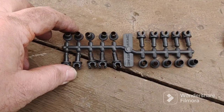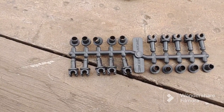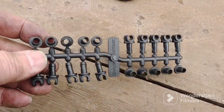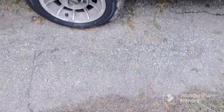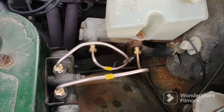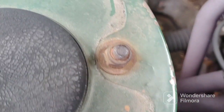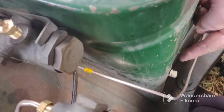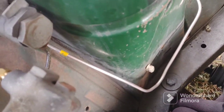Moving along — I did the left front, and I did the two brake lines coming off the master cylinder going to the proportioning valve, which I'm going to show you. I'm going to replace these brake line holders. Then I'm going to put the grommet in. This is what I've done so far. It took a long time because I'm definitely inexperienced with this. The line was a little long so I couldn't reach one clip, but maybe I can bend it into the clip because these lines are flexible.